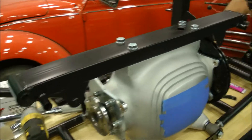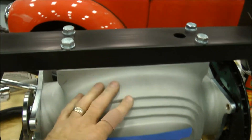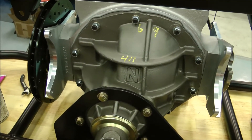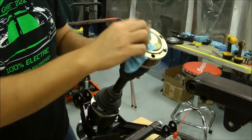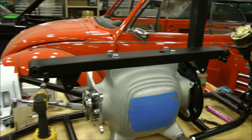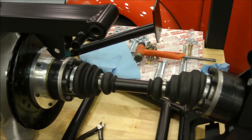As you can see, the independent rear suspension setup is slowly coming along. The axle shafts are inside the carrier with the ring and pinion, which has been mounted. The carrier bracket is going to bolt to the frame of the car. You've got your top carrier here. Joe's now working on the CV joint to go in, and we have the arms hooked up. Everything's left loose — nothing's going to be tightened yet until we get it all assembled, and then we'll use a transmission jack to actually lift it up into the car.